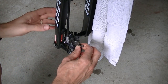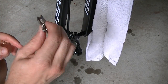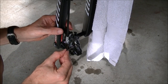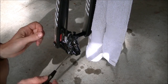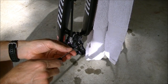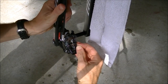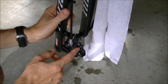The final step is to drop your brake pads back in. There is a little spring inside with the brake pads — so that's three pieces: the two pads and the spring. Drop them back in there, line up the holes for the bolt, put the bolt back in, and snug it up with a screwdriver. This part does not need to be crazy tight — just snug it up. Don't forget the little cotter pin that needs to go on the side to hold it in place in case the bolt were to come loose.